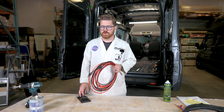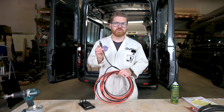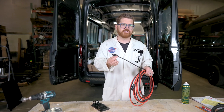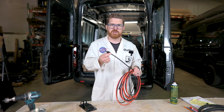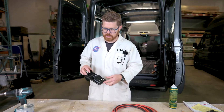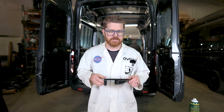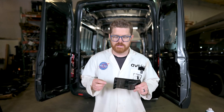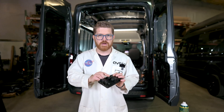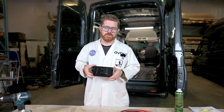The parts we need for this step are our solar cable. This solar cable comes pre-wired with an MC4 connection on it. That MC4 connection is an exterior weatherproof connection that's pretty much standard on every solar panel out there. We're also going to want a Go Power solar entry gland. It screws down so it's not relying just on glue, and has rubber grommets that are going to keep our van watertight — it's generally the best one I've found.